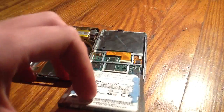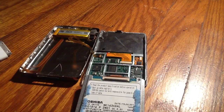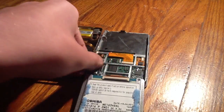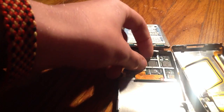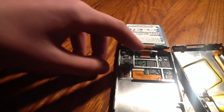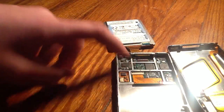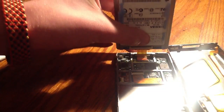Mine is totally messed up so I'm totally gonna have to take it out. But before you just throw yours away, I'll flip it upside down to see it better — this little orange strip is the main thing of focus. You gotta flip this tab back to allow it to open, and do not directly pull the orange tab away from the hard drive. That will completely deactivate it and make it unable to put back in. So after that, you pull it directly away, and if it's just misaligned or whatever, you can try putting it back in.